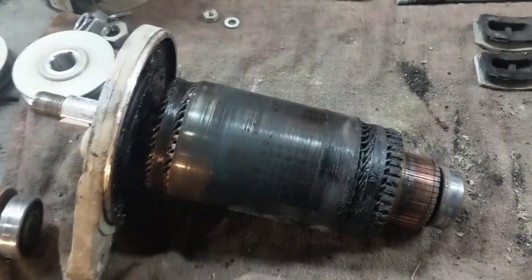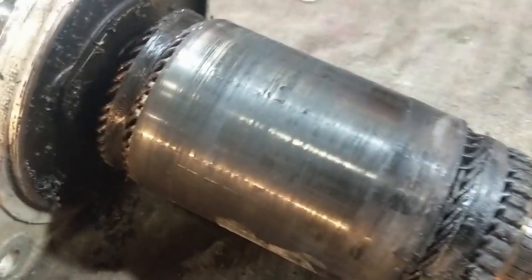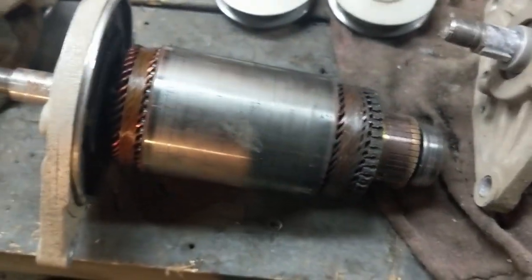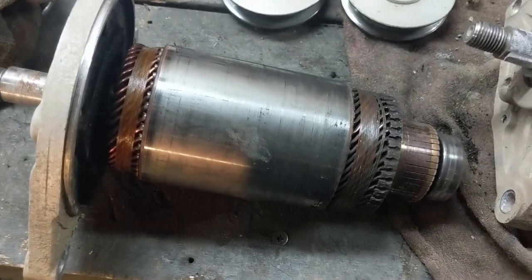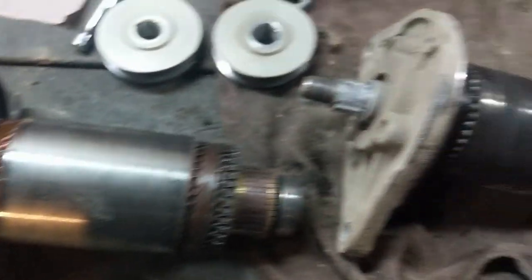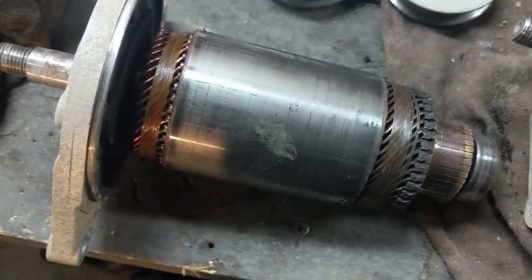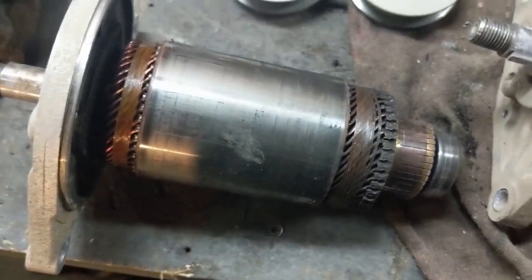Alright guys, we've run into a bit of a problem. The parts unit — the one that melted down — the commutator is toast, burned right out. So instead, I'm going to polish up the worn commutator as best I can, clean it up, swap those brushes, and see if we can get another season out of this starter. If not, I'll order a replacement unit, because I don't have enough good parts here to build another starter.